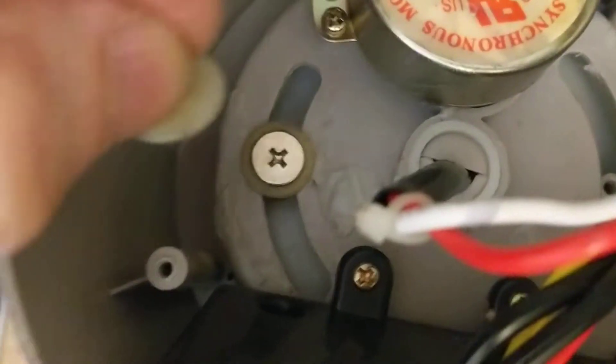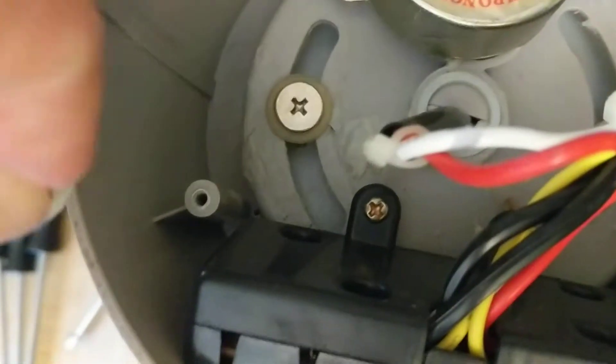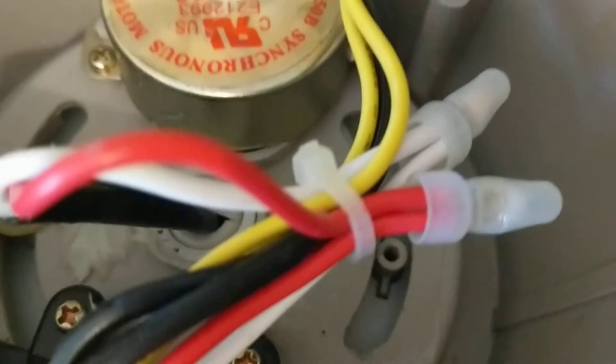These are the screws that go into the oscillating base. Don't put them on too tight because the mechanism has to oscillate, and the Teflon washers sit on a greased surface — you want to preserve that grease. You can snug them up because the screw will only go in so far, and once it's in that far there's still a little play, so it won't over-tighten.